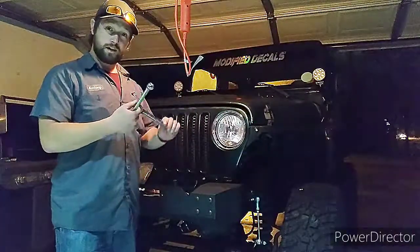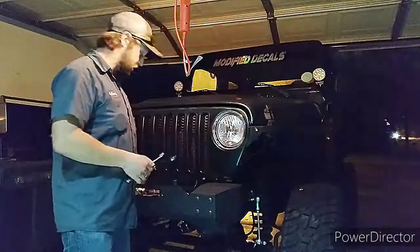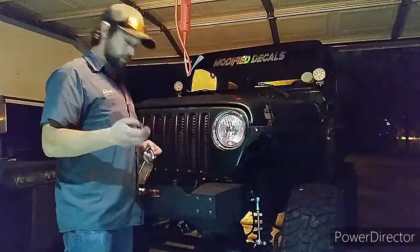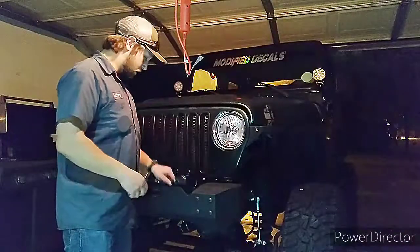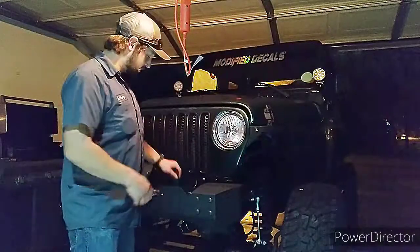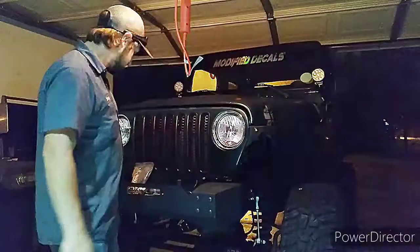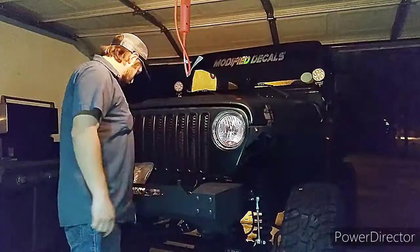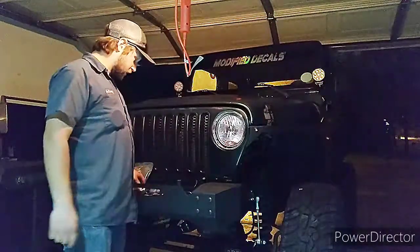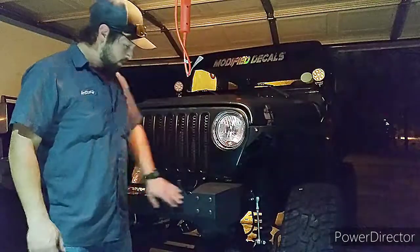Make sure you get one of the ratcheting end wrenches, because it will save your life, let me tell you. So you might as well have yourself a socket that's a 19, a 17, a couple extensions, and I had to use a 16 to get that bolt off on the side there, the bolt that goes through the steering box, to remove that steering box skid plate. I used pair pliers for just random stuff. You need a flashlight.